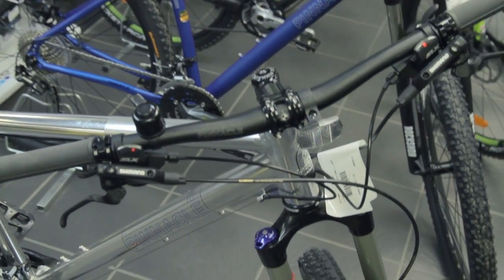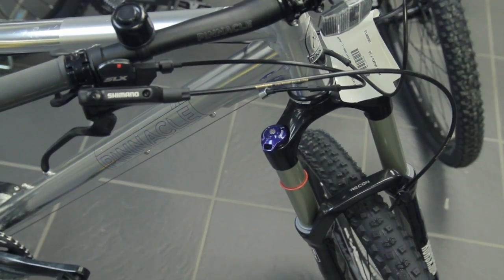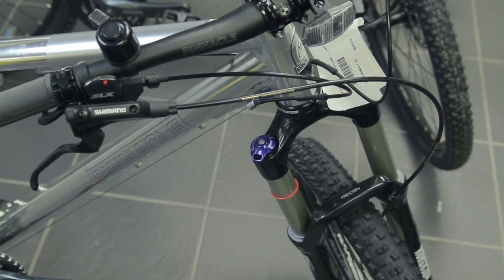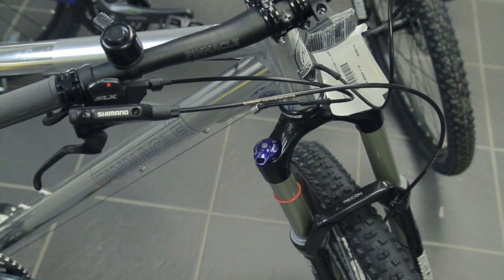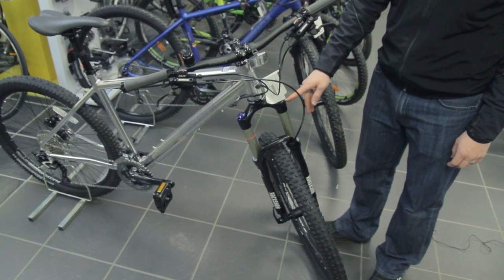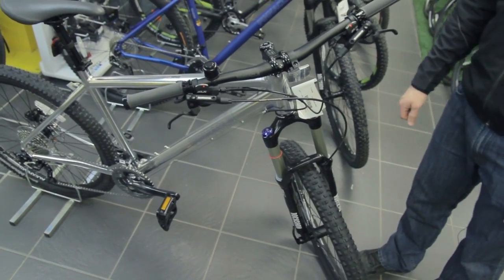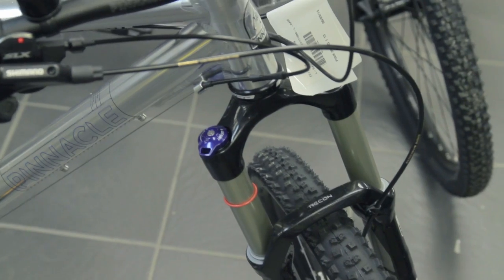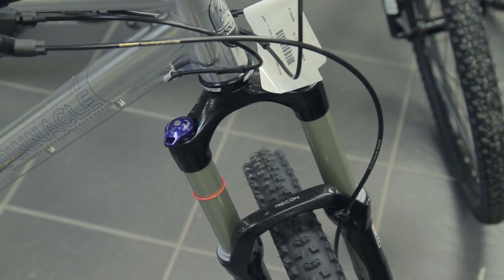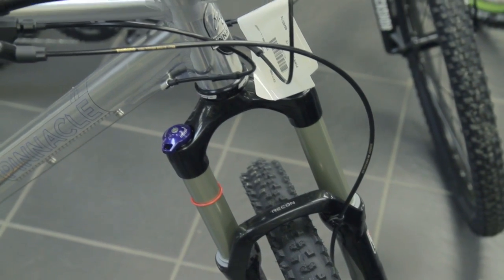However, you will have a relatively short or mid-travel suspension fork to help with the bumps coming through the front end of the bike and the handlebars. Most importantly, this suspension is there to provide grip and control when the terrain is more exciting, shall we say. And one of the other important parts to do with suspension I was going to mention is travel, which means the amount that this suspension fork is going to move with impacts. This is going to be limited by the physical product. Some will be designed for shorter travel than others that will be designed for longer travel and essentially bigger bumps.